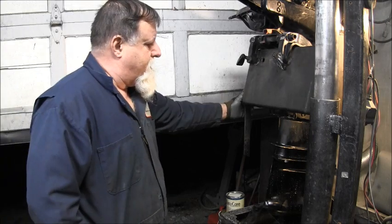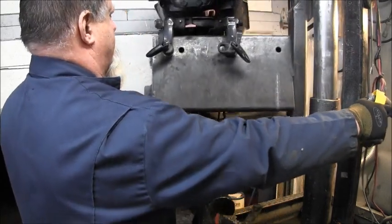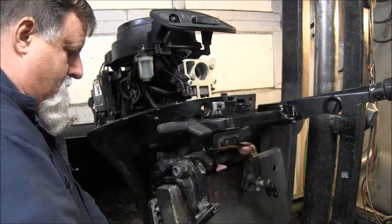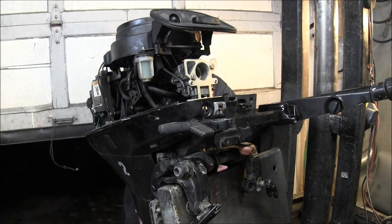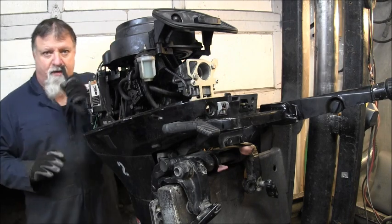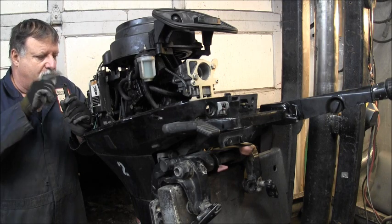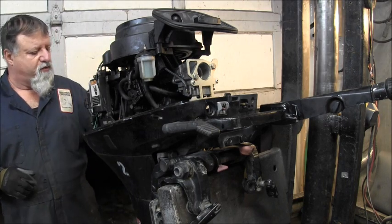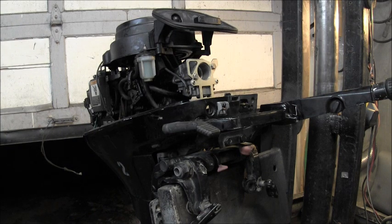And if it's going in gear, I didn't see nothing really. So let's take a look. First, I want to look at the water discharge and see if it is hooked up. It is hooked up. Yep. And nothing. I pulled off the water discharge tube coming from the exhaust port cover, and all that's coming out of there is a little steam. So that's that.